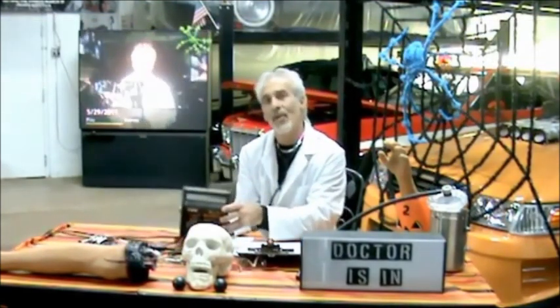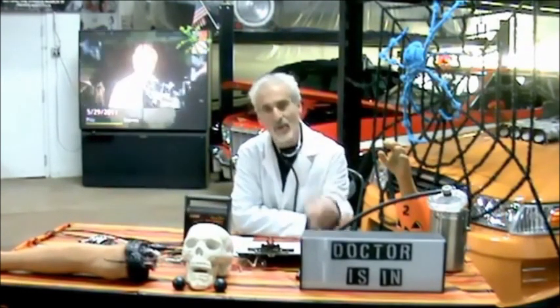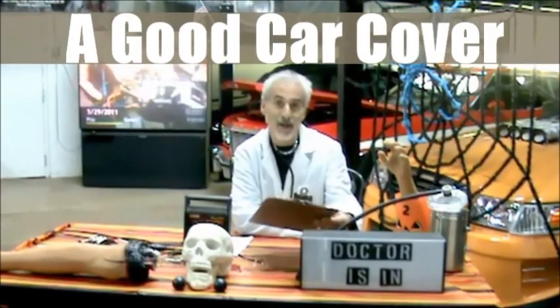For the battery, I always put a battery tender on my batteries over the winter on all my cars. These little units will let your battery last almost 10 years — I've had a battery last 10 years by religiously using a battery tender. If the car is going to be in a cold garage, take the battery out and put it somewhere warm like the laundry room. Put it up on a piece of wood and connect a battery tender — next year the car will start right up with plenty of power.